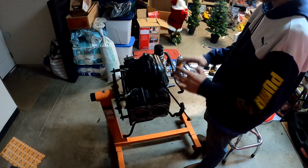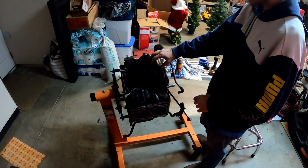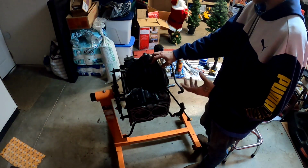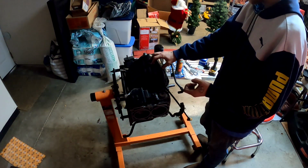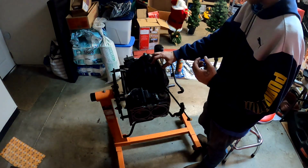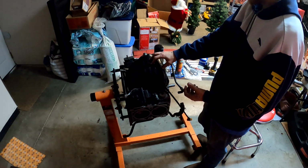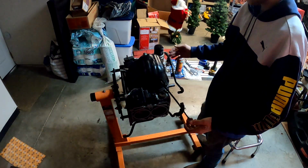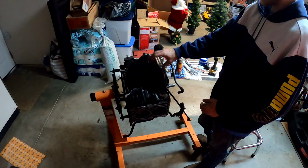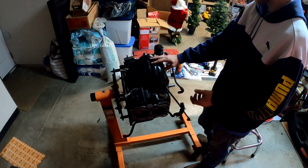Okay, so if you're all gung-ho about getting this resealed and getting it back in the engine, you do need to wait 24 hours for this to set up. That's pretty standard for any RTV, because you don't want it getting hot before it's fully set up and dried, because then it won't ever seal properly. There are some other silicone gasket makers out there that cure faster, and you can use the product sooner after you apply it. But it works out here, because I'm waiting on my heads and other parts, so I can't build this engine fully and drop it in right now. So it's going to have plenty of time, like a solid week, to set up. Just make sure you're not rushing it. You don't want something like this to be leaking. You want it done right.